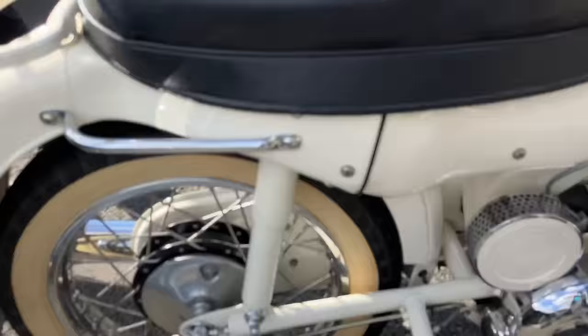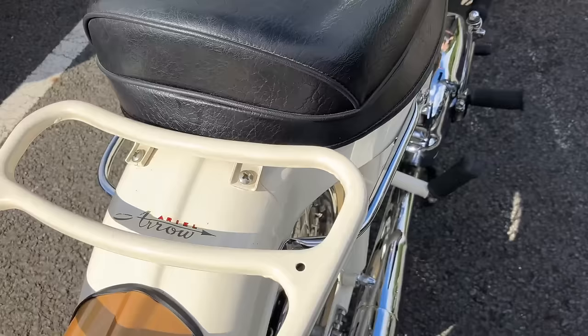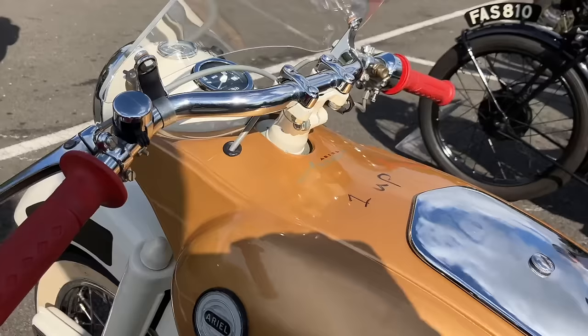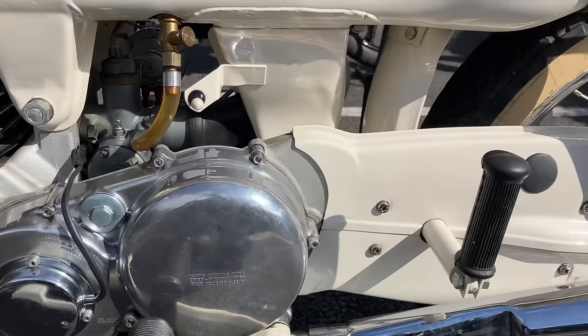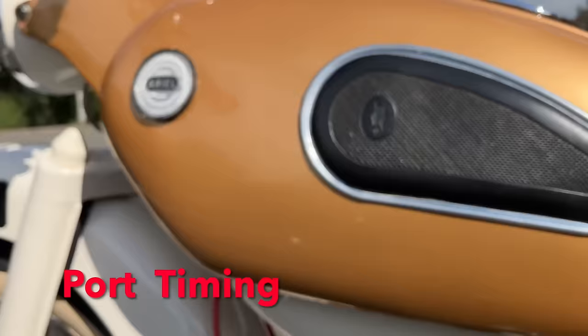When it's true that they share the same basic dimensions of 54 by 54, this is a very common dimension for 250 twins, whether they be parallel or V-twin, particularly in two strokes. In fact the NSR 250 V-twin from the 1980s uses the same bore and stroke, and ditto the RGV250. Are they also copies of the Adler? I think not. They just happen to be the most effective dimensions for a 125cc cylinder in a two-stroke engine.